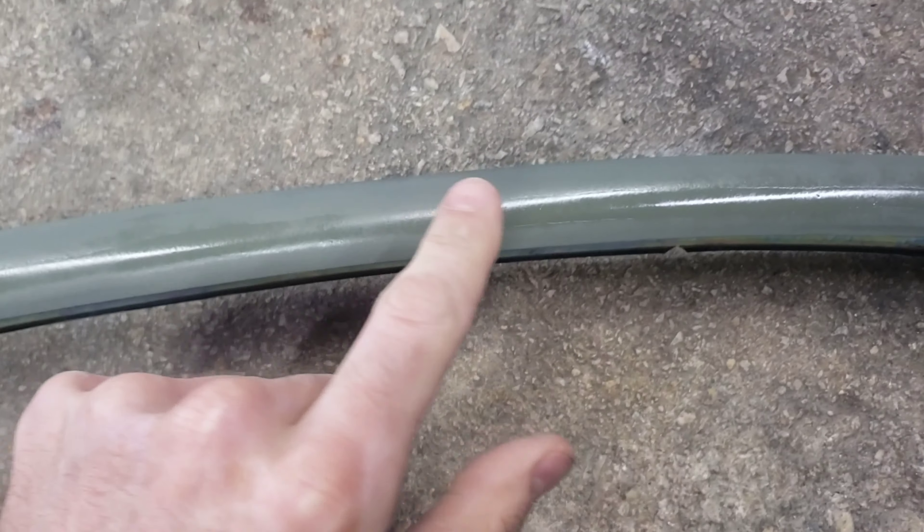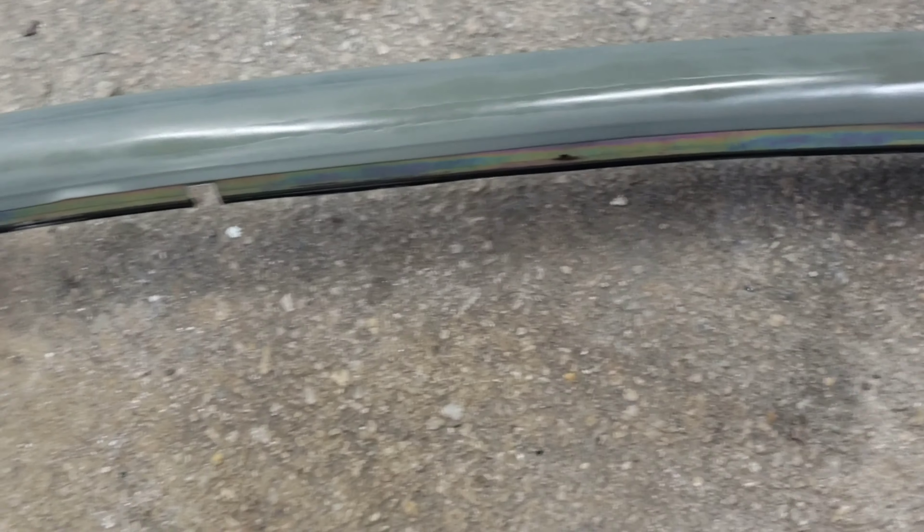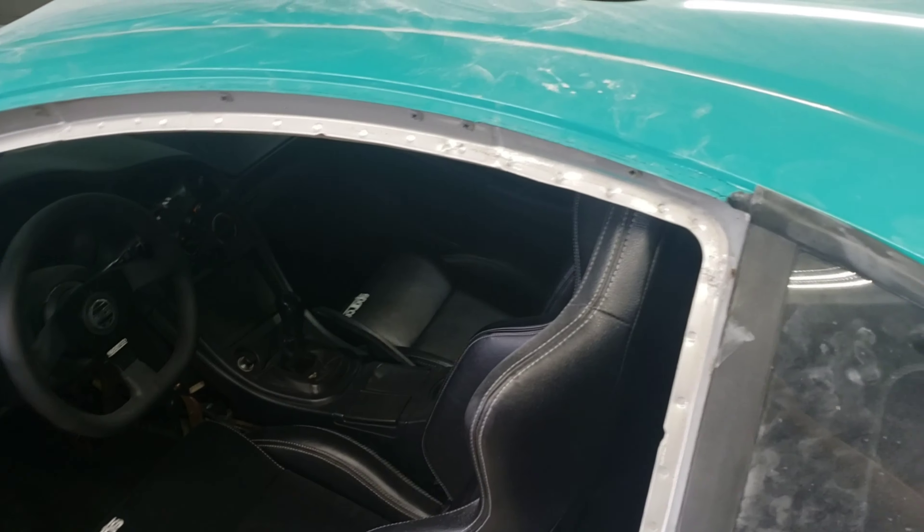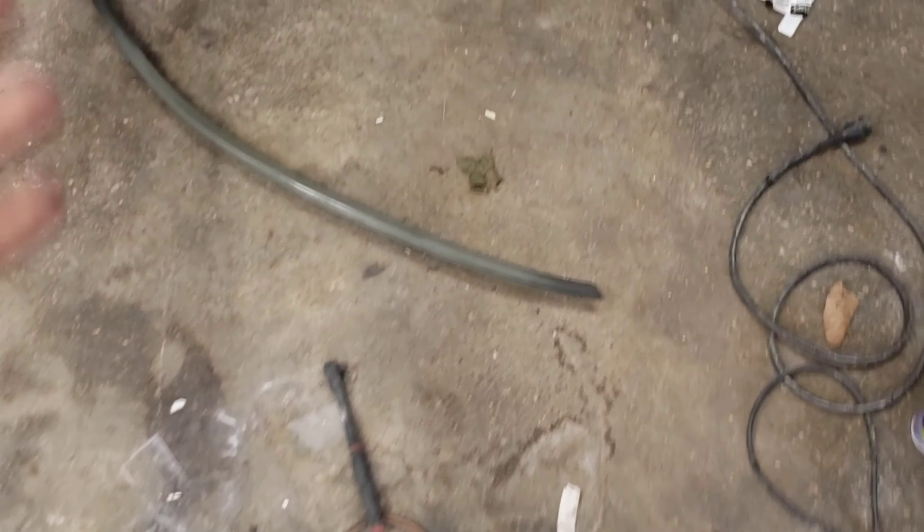So while I was over here working on the door, I had this door sill off and it was in pretty rough shape. All of this was kind of down to bare metal, so I put one coat of etching primer on it. Then I'm going to put a coat of regular high build primer on it, and after that I'm going to go over the whole thing with some trim black. Hopefully it'll match the rest of the trim and look good as new — won't look all peeled anymore.